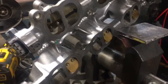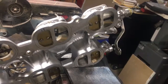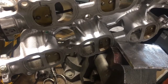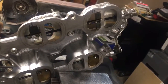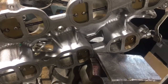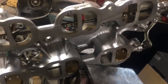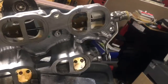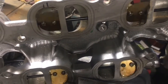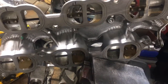When it does, it moves these butterfly valves back and forth. The purpose of this — some people, when they explain it, say it makes your intake runners longer or shorter, making the air take more time to get to the cylinder at certain times. It increases the volume. I'm not sure if it really makes it longer or shorter, but it does increase the volume.